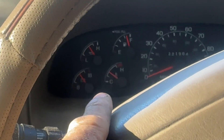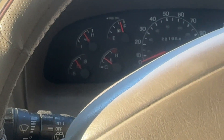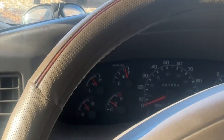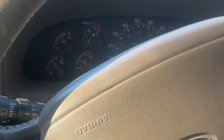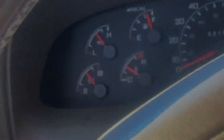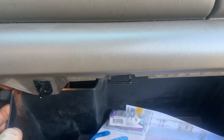Also verify that you got heat on your gauge up there, but I don't think that's high enough. I think the thermostat might be open. The back half's not heating well either, so I think we have a circulation problem - either a bad thermostat or a blockage somewhere. Just gotta start checking all that.